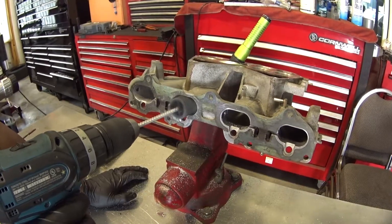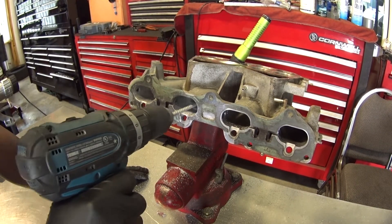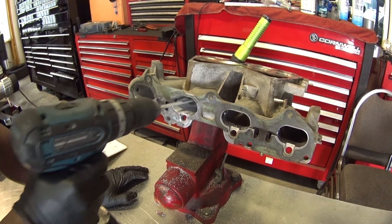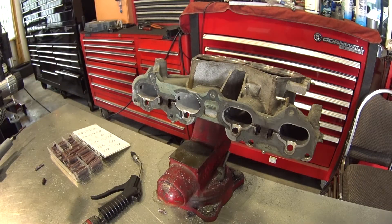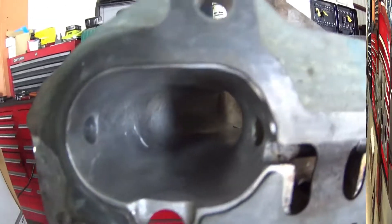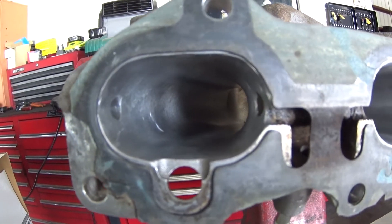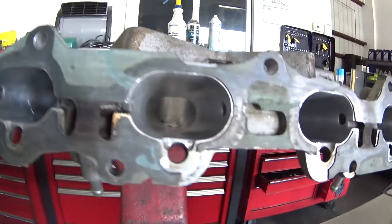The flex hones come into play only due to the fact that I didn't have long enough arbors to reach deep into the port with regular sanding rolls. The flex hones were only used to help smooth away some of the rough textures and casting lines of the runners. The hones I used were 120 grit and 180 grit. You can see some damage to the runner wall in the last port where I couldn't control the speed of the tool — it dug into the wall and made some nicks and cuts, but nothing that a 120 grit sanding roll couldn't fix.